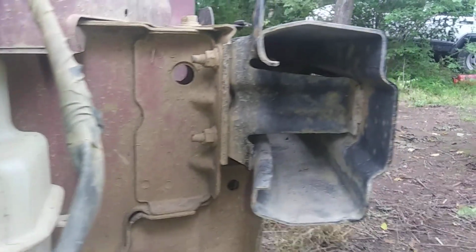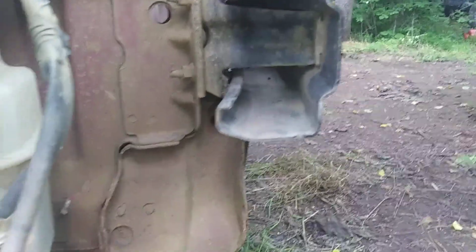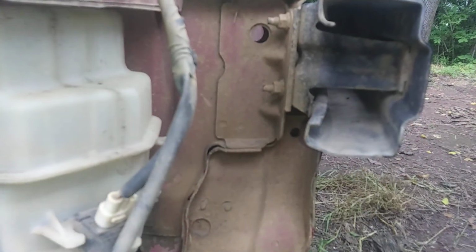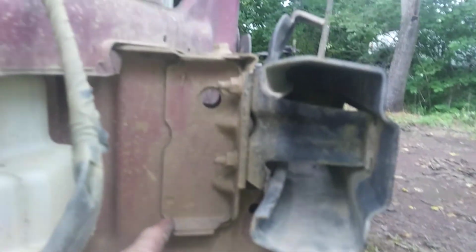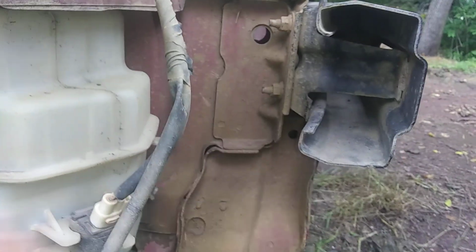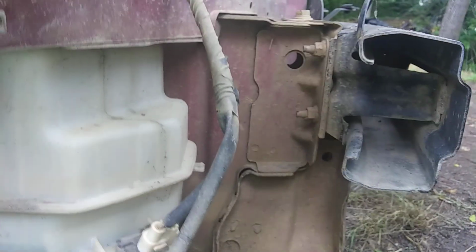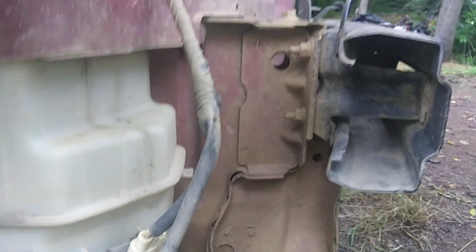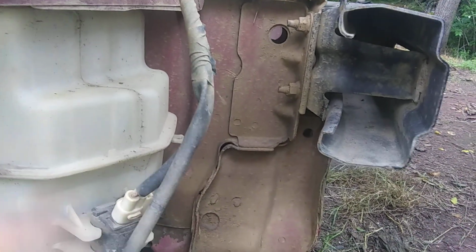I would not run this bumper in a stock show. I'm not going to run this bumper. I'm running a 2x6 1/4 inch. But this frame, I'm really impressed with this frame for a really stock show or gut and go, or maybe even weld if you're allowed to seam weld your bumper mounting components. Or my county fair, you're allowed to reinforce this a foot back. You're allowed to put just about anything within the first foot. So this would be pretty half decent welded up for the 4-cylinder class.